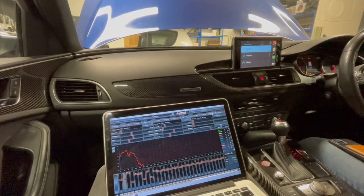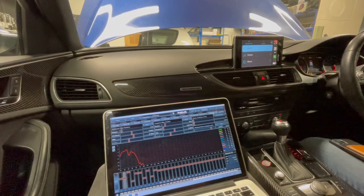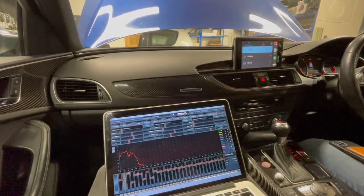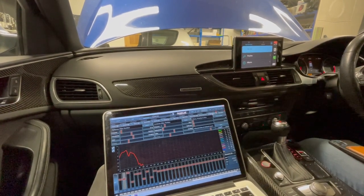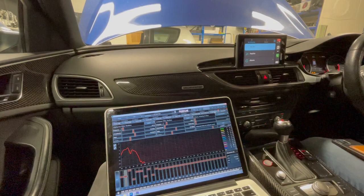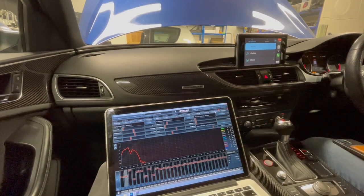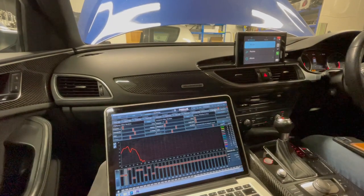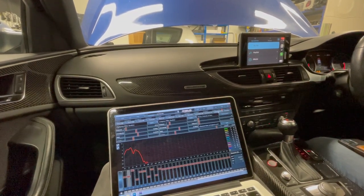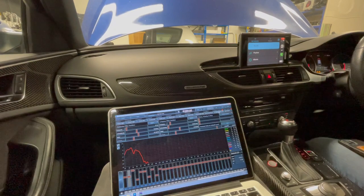This system isn't just using many bands - it's EQ'd intensively, but when you use EQ at the right places, knowing how to measure, what technique to use, how to set up mic calibration files and all the settings to get the right reading, then you can apply changes on an accurate picture. If you measure wrong, you base everything on a false picture and everything becomes crude. Then time alignment - how do you get the speakers in time to play together, and how do you confirm they actually do? All these little things can take you very close, yet miles away if you screw one thing up. Screw three or four things up and it escalates.